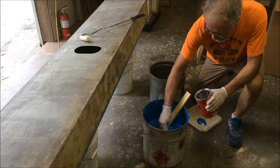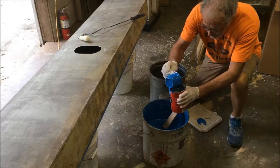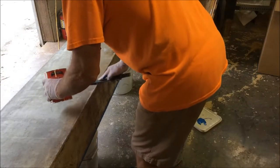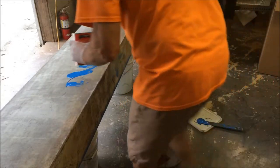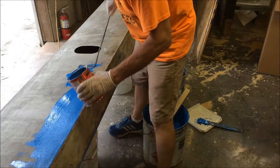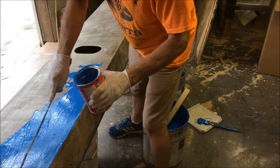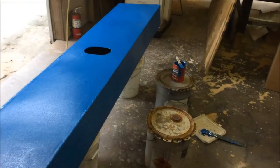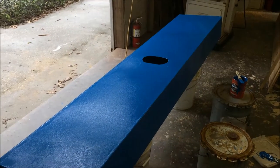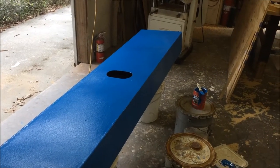Equal parts. I don't try to pour it — I just use a scooper and let it float around in there. It's beautiful. It's done. Because I have so much of this paint and it's so easy to apply, I'll probably put another coat on it — flip it over, paint the bottom, then the next day flip it back and put another coat on the top. This is almost as good as just brushing on straight epoxy. It's very tough stuff.